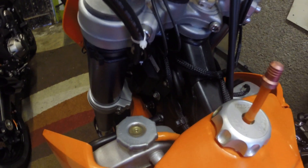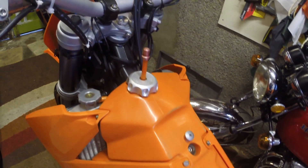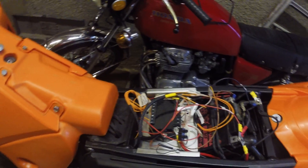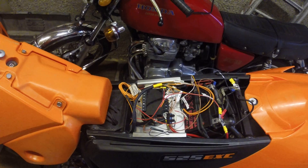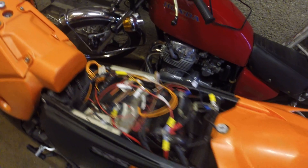The stock parts are the CDI, which is the same, and the stator is the same down the bottom. It has all been rewired with PTFE stainless steel core wire, which is this stuff here — it is pretty well everything-proof. So if it managed to get near the engine or something like that it wouldn't melt.